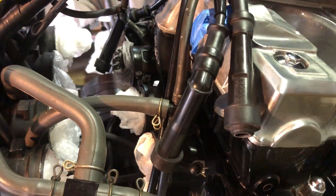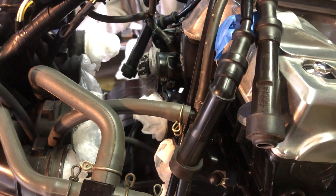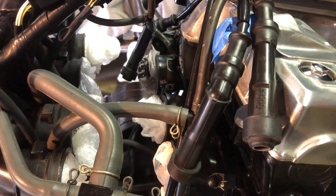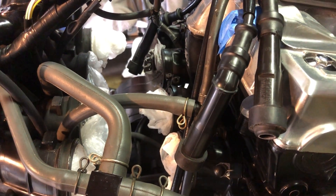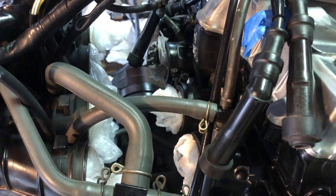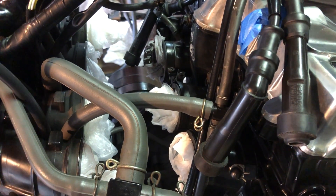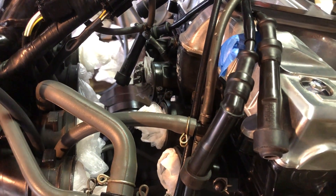In this particular case you can see the carbs are out of the bike. Sometimes people wonder whether or not it's a good idea to do a compression check cold, and there's absolutely no problem with that. I did cold and got 160 psi across the board. I just had to make sure my intakes were obstruction-free, so I removed these little plugs when running the test to allow the engine to breathe.